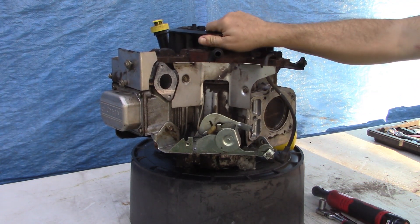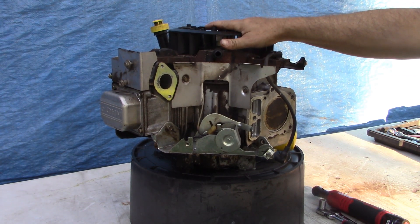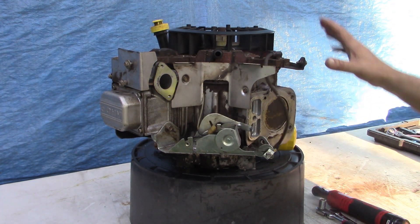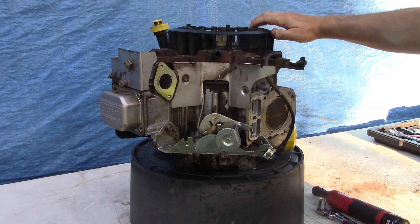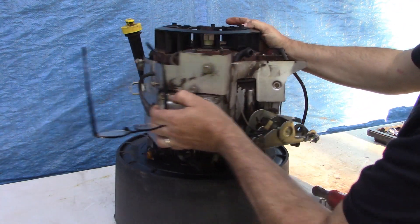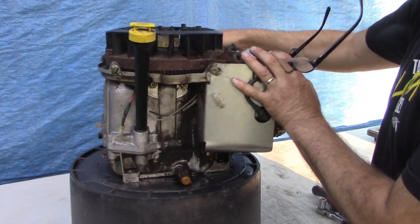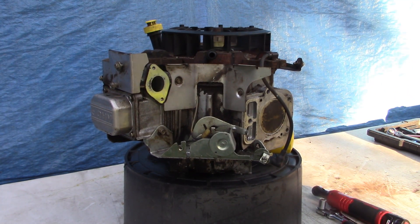So this is it. I removed it from the machine, and what I did for my friend is I had another one of these engines that I put in his tractor — a couple of years newer — and it's running great right now and the tractor's back with him. This one's sitting here ready for us to tear apart. I had to take some of the components off of this engine and use them on the other one, including one cylinder head. This was the one that was firing, as you can see the piston here is moving in and out. I took the intake manifold and the carburetor. So some of the components from this engine are still being used on that tractor — just swapped them over to the other engine. Fingers crossed; so far it's working great.